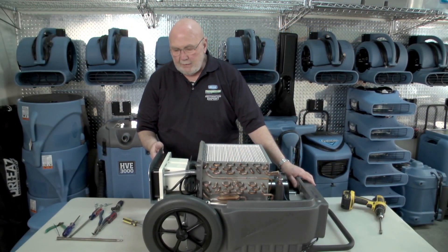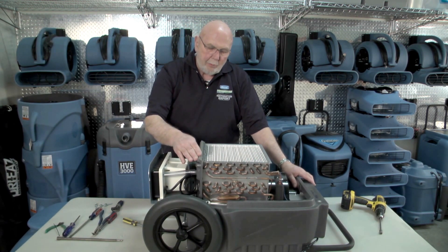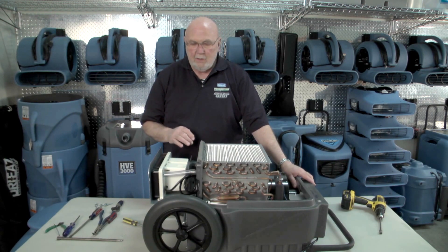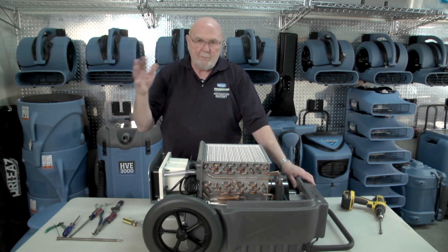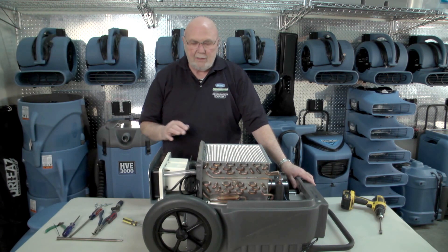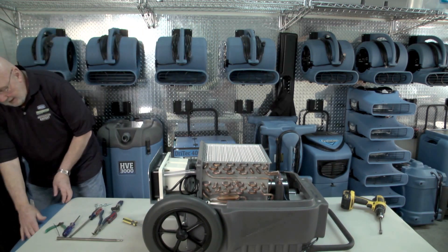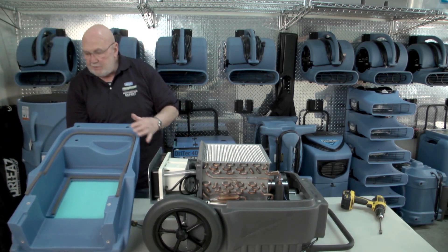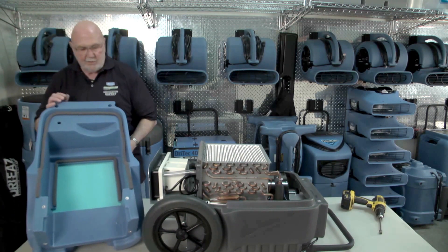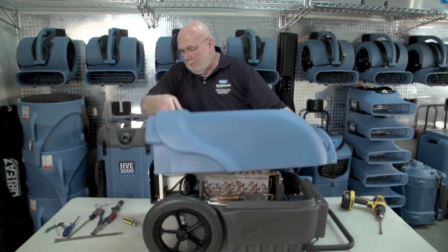After reassembling, you just want to do a quick visual inspection and make sure everything is clean. It's always important with all dehumidifiers to pay attention to the gaskets — they are here for a reason. Every bit of air that comes into this unit is controlled and directed, and these gaskets are very important. You also want to inspect the gaskets on the cover themselves and make sure they're solid and in place. On this unit, I lay it down and start all of the bolts before I tighten any down.